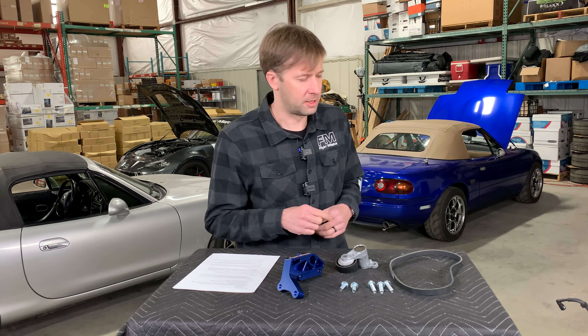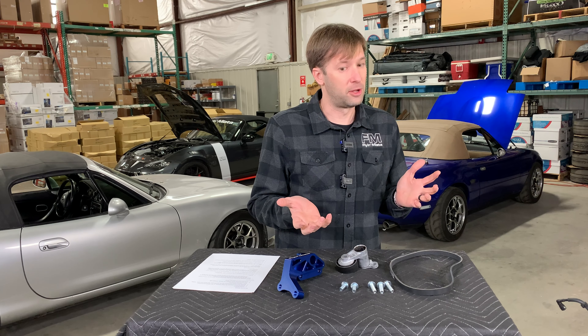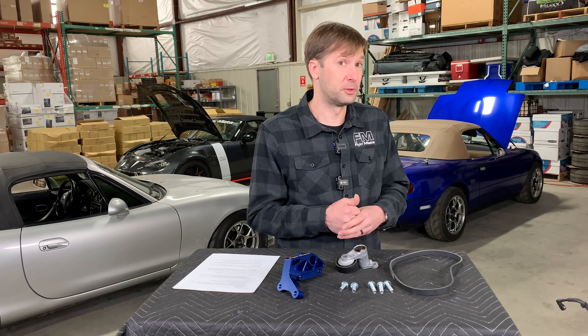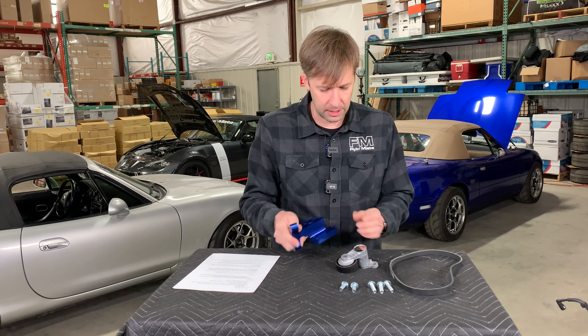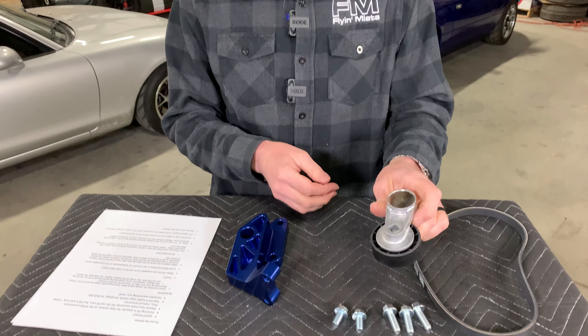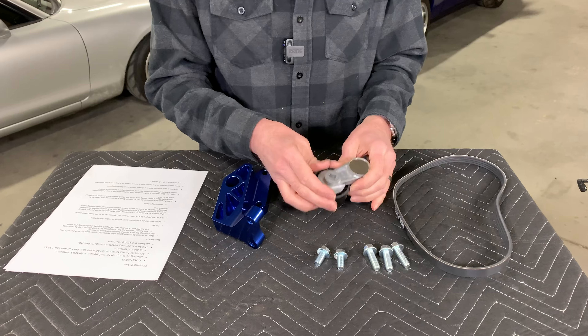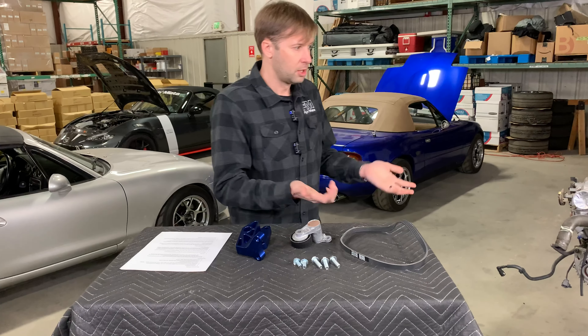I get a lot of questions here, so we'll talk about some specifics later on. That's super easy to do if you want to delete the power steering and the air conditioning. If you want to keep the air conditioning, that was really easy because Mazda used to make a bracket that bolts onto the side of the block, but they don't make it anymore. Used versions average around $300. So we have come out with this kit - a CNC machined aluminum block adapter, an auto tensioning pulley so you don't have to mess around with manually tensioning anything. It comes with all the hardware you need and a belt, which is available anywhere.